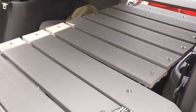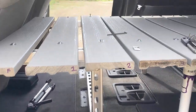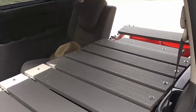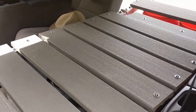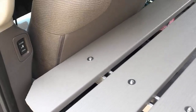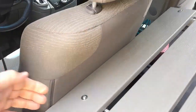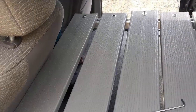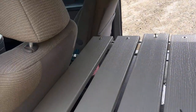That's the bed system. You don't have to build it the same way I did, but it might give you a starting point rather than all these plywood beds out there. Plywood is really heavy, it flexes unless you buy the real thick stuff, and you have to be a fair carpenter with some skills to put it together. I don't think it's the best system for everybody. Looking around, I didn't find any other construction methods I thought were suitable for the van. The bed goes up against the seat, so the seat supports it from coming forward — there's a steel frame in the seat, and the floor supports will hold it. In the event of a collision, it's restrained as best as it could be, and you can add cables at the bottom to hold it. Hopefully you find this useful.